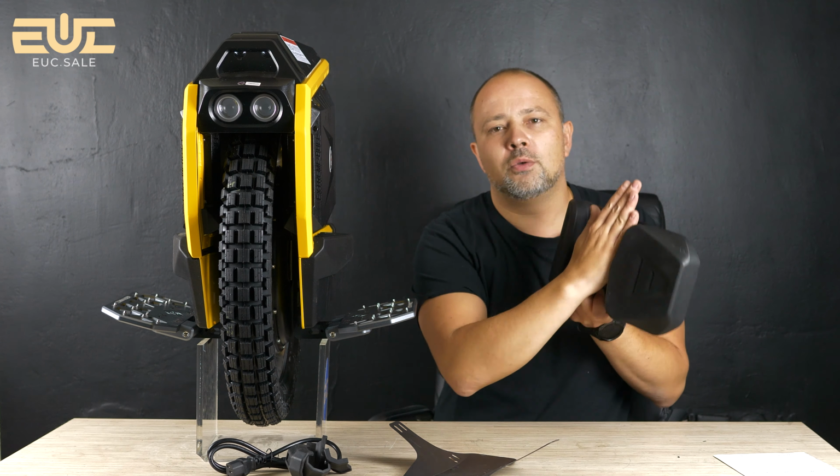Second one, the battery compartments are in their own boxes, and these boxes are built from two parts, you know. You can just unscrew those boxes and you will see the normal Begode 900 watt hour packs inside. So you can additionally put silicone, screw it back, and also where the wires come out of that place, we also see from the factory it's already hermetized with silicone or some type of hermetic. So it will also easily be 100% hermetized here. So it is really a good point. And if you need to remove the packs, you just unscrew a few screws, unplug it, and you take all this part out of the wheel.